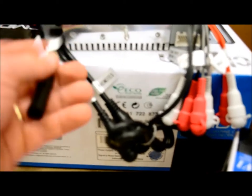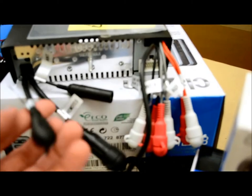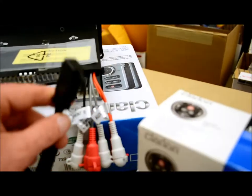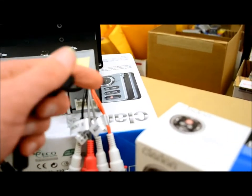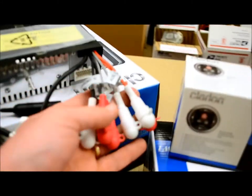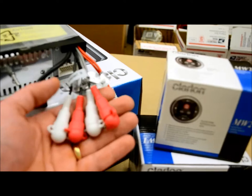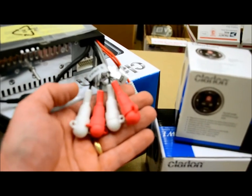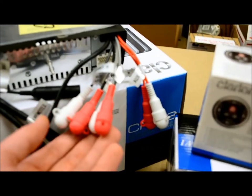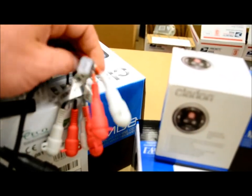On the rear, just real quick so you can see: antenna, two plugs here — one for a hardwired remote which is optional, and one for the Sirius XM. On the back, there is the USB with the watertight removable cover. Varying from the CMD-6 model, this unit has two channels of RCA preamp outputs, which can be front and rear, or front and rear converted to a sub. And there's a standard composite RCA input as well.